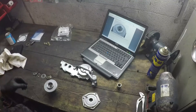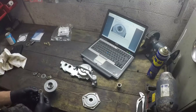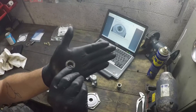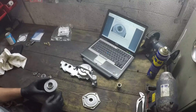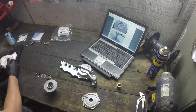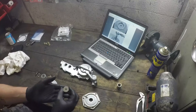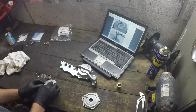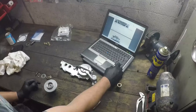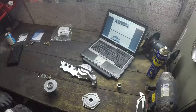Now I'm going to take the piston and remount them. The bottom thrust roller bearing has to go in — there are two ways around, it has to go this way round just for reference, not that way. I want to just lay that down and let it drop in. And now the centre washer needs to go in — the washer can be inserted in either orientation, so again I'm going to use the surface which I believe to be the worn one up this time. Then we install the spline shaft mounting bolt — left-handed thread, T30 Torx bit socket, quarter inch ratchet, eight newton metres left-hand thread.